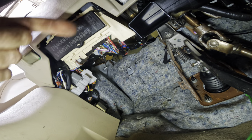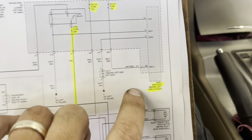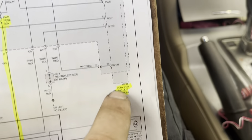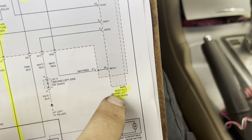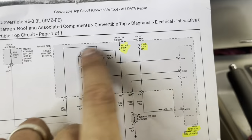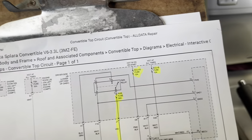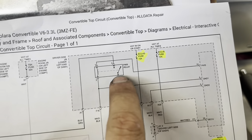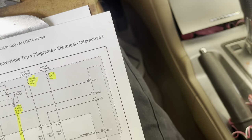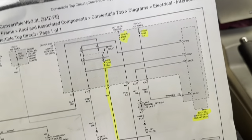Back to the diagrams. I need to issue a redaction: I was calling this the main body ECU, which I knew didn't sound right. The BCM — main body control module — is located within the driver's side junction block, which is the fuse block we were just probing. Behind all those fuses it has a power relay. The body control unit is integrated into that assembly.